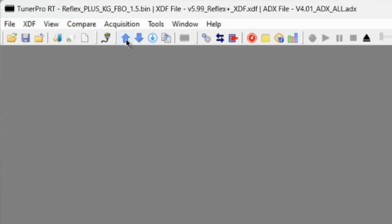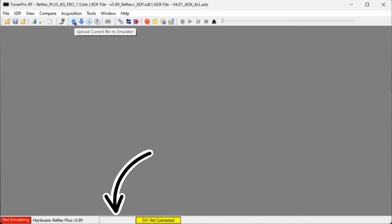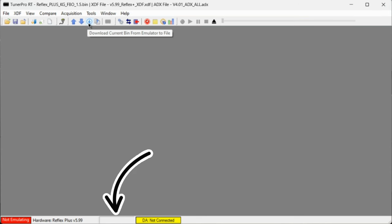Each of these buttons has a distinct sequence of beeps to confirm it's working. When you click the connection button, upload button, or verification button, you'll hear specific beep sequences for each successful action. You'll hear those beeps every time you get a successful flash. Also, at the bottom of the screen, it flashes a little green successful label — that's further confirmation you're flashing properly. There is a little red icon on the left that is always there, but it's normal and doesn't mean you have connection issues. Just ignore it and look for that green label. If it doesn't work, it'll flash red and tell you it was unsuccessful — that's what you actually pay attention to.